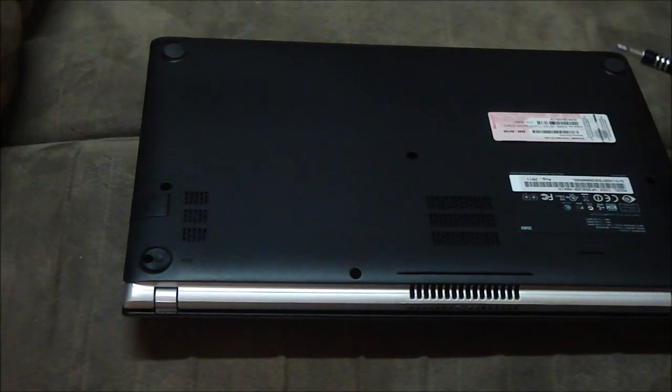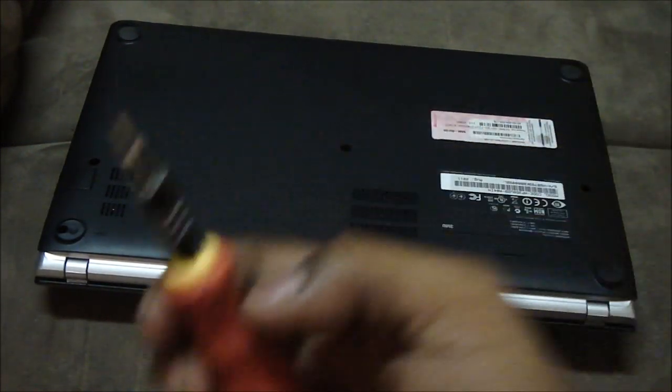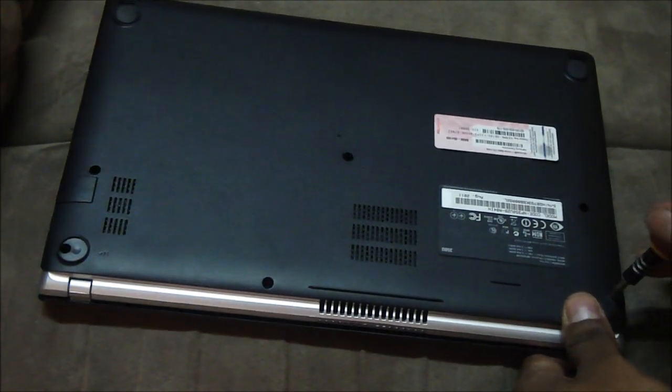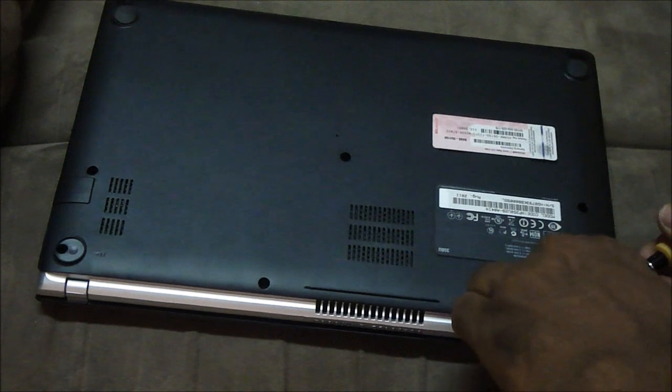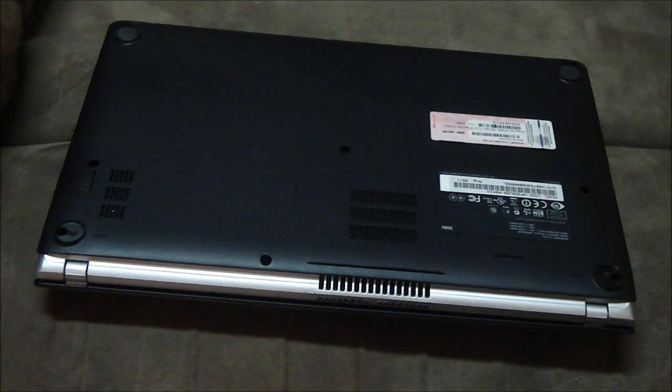Not the other two — not the ones by the keyboard — but the ones by the hinge. Take a flat head screwdriver and just pop it in and pop the pad right out. I've already done one; it pops right out, just keep it somewhere. Now go back to the star screwdriver and get these screws out. I'll be back once I'm done with that.